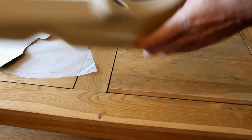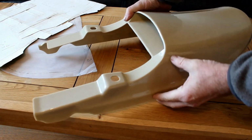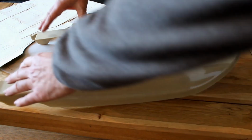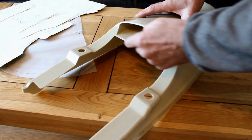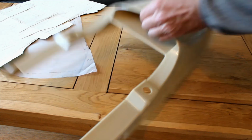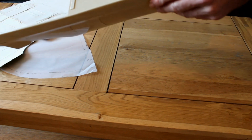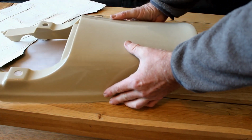I'd also not have this little flap here, and in fact, thinking about how it might be made, I'd probably have to make it in several pieces. We'd make this outer layer first, roll it, and then bend this bit over, and then we wouldn't have anything here, so we'd have to cut out this shape and weld it in place, and perhaps even weld in a strengthening piece here to give somewhere to put the rear lamp. So it's not easy, but at the same time it's not impossible.